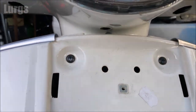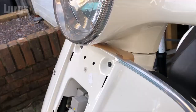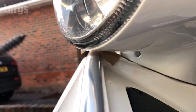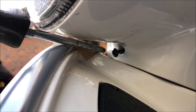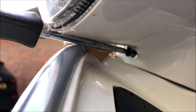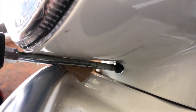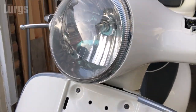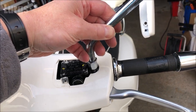Now the bit I'm dreading: the headlamp screw underneath. As I mentioned earlier, this is a magnetic screw so if you've got a really powerful magnetic screwdriver use that. What I've got here is just a piece of tape — upside down so the sticky side is up — just in case I drop the screw it should hopefully stick to that tape. It's easier to get this in if the headlamp unit is turned to the side, which gives you slightly better access, and the thinner the screwdriver the better because you will start rubbing off some of the paint underneath. Great stuff, that one's in — that's the trickiest one.